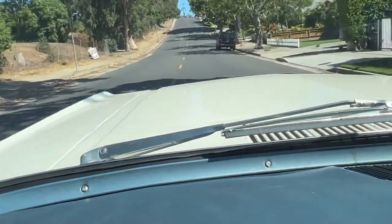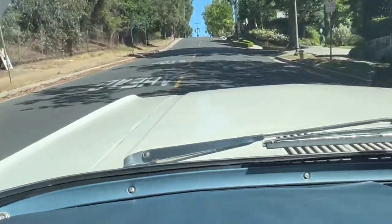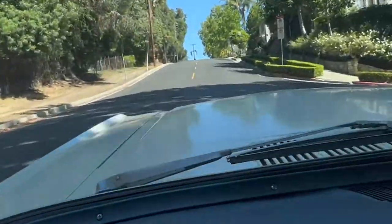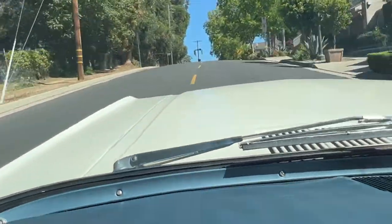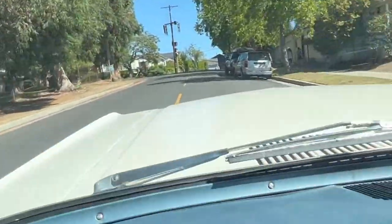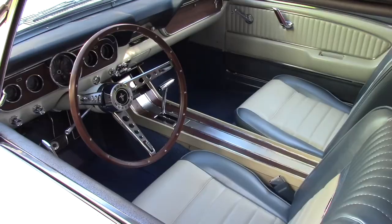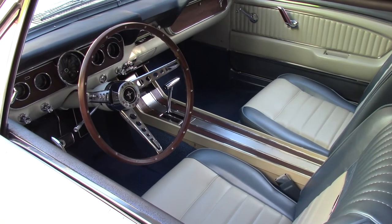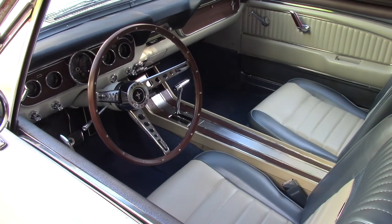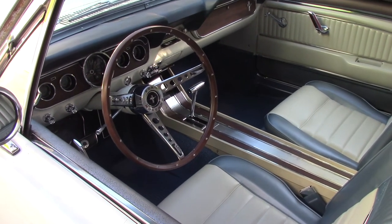So anyways, just a quick repair. Sorry I didn't show installing the actual bushing, but it's just too hard to get in there. There's lots of videos online. So anyways, we'll wrap this one up. It was definitely important to have the right tools to do the job. I highly recommend changing that bushing if your trans hasn't been rebuilt and verified that the bushing's been changed.